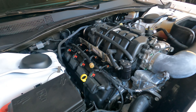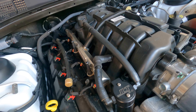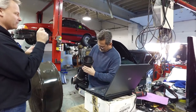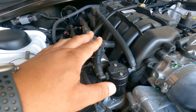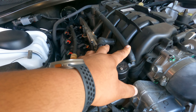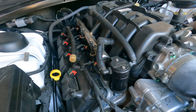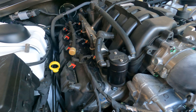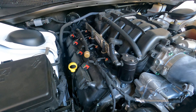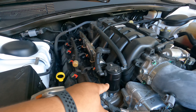These are relatively inexpensive. Of course, this isn't the only oil catch can on the market, but I've always gone with JLT because they're a local company, I know the owner personally, and they make quality product. This is made of billet aluminum and includes the hoses you're going to need, so it's basically plug and play. You just remove the existing hoses, put this in place, bolt it down, and when you want to drain it — which you'll want to do probably every 2,000 to 2,500 miles — on average you'll see about an ounce of oil captured for every thousand miles.